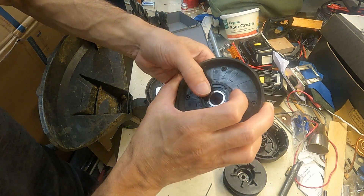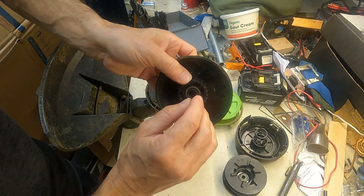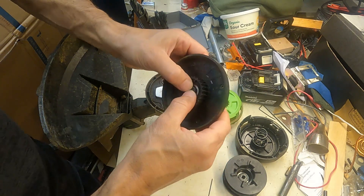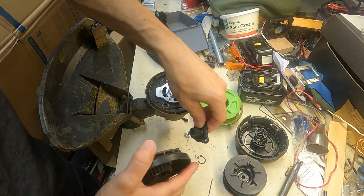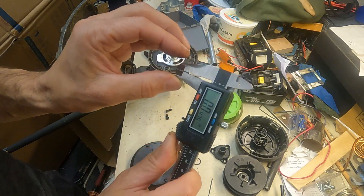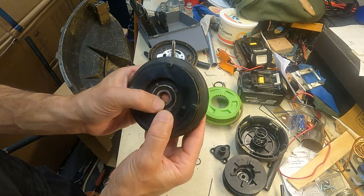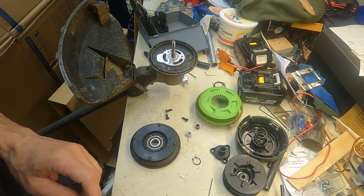So I'm going to see if we can fit this in here, using the bearing cutout as a guide. Put a small drill bit down there to cut into that plastic a little, and find a piece of metal to use as an actual key — maybe we can get it to hold. I cut out a little piece of metal but that's only about 0.47 to 0.48 inches, and it fits pretty much flush in there. We need almost twice that depth, maybe 0.80 to 0.90 — gotta find a scrap that's a bit thicker.